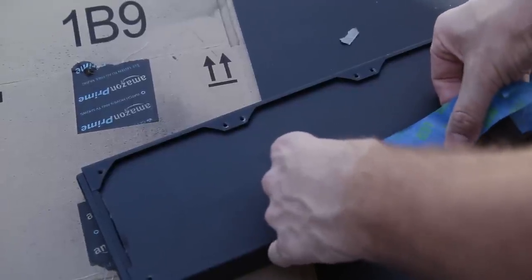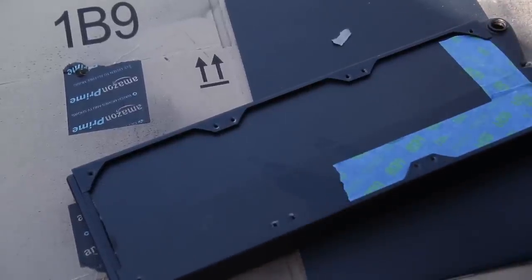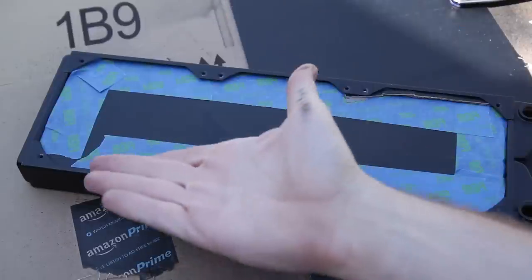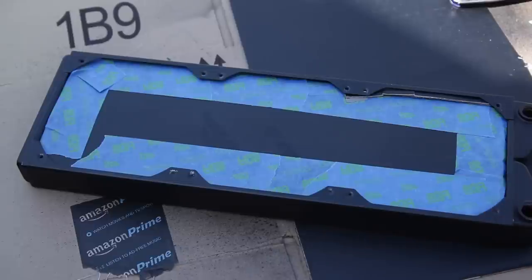The cardboard provides physical protection for the fins, whereas tape doesn't — so if something bangs against it, you won't smash the fins with cardboard like you would with tape. The bottom line is you want to protect the fins from overspray and damage, and keep it snug against the shielding of the radiator so you don't get overspray down inside.